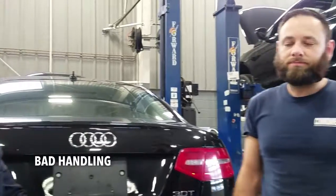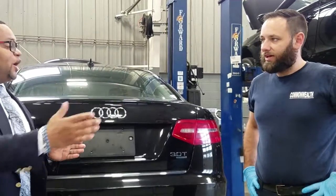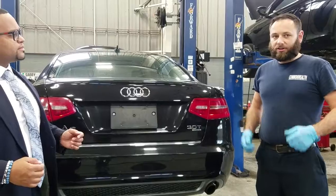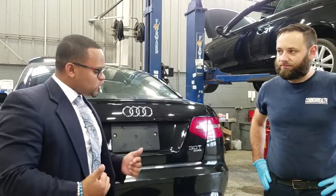No kidding. So that's how you're driving straight, you want to take a right and your car keeps going straight. Yeah, absolutely. That hydroplaning, that contact patch being affected by the tread there is going to make it so that your handling's a lot less, and like I said, stopping distance goes up 2 to 3 times. Wow, no kidding. Let me ask you this as well.